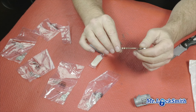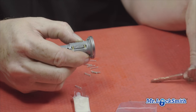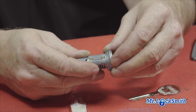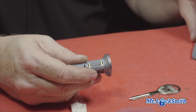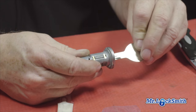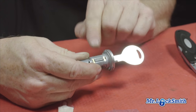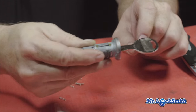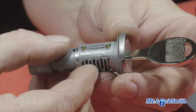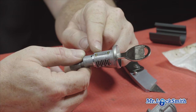It's very important that you have the right wafers in. You can put these wafers in and when you put the key in, it'll clear the shear line on both sides — but if the sidebar doesn't drop, you'll never turn your ignition. We're going to line up a different depth cut on this key with this number three wafer so you can see: the sidebar is sticking up a bit, whereas when you put the key to the proper depth three, the sidebar drops completely flat.